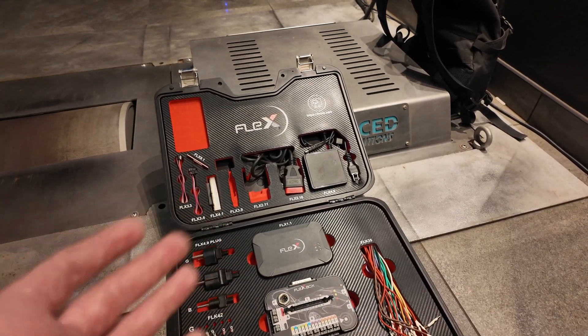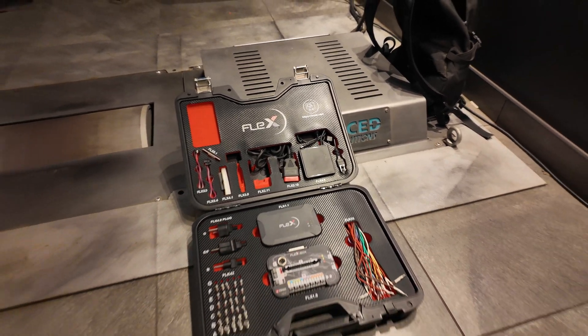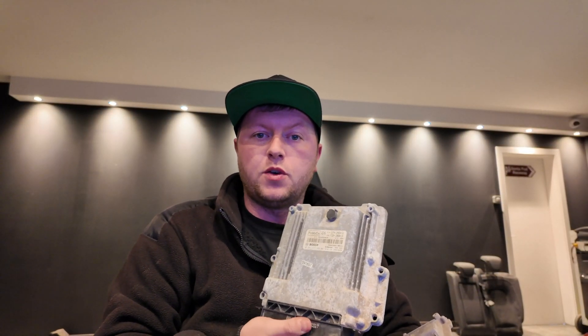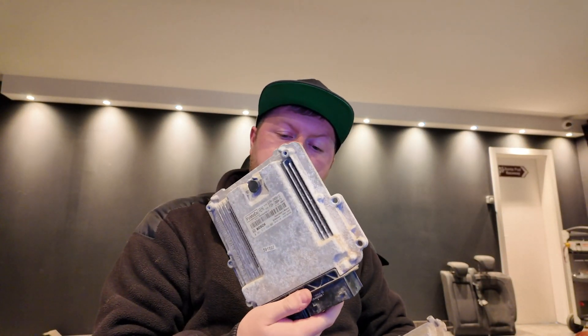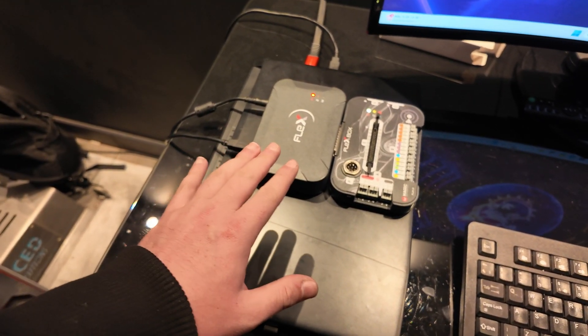The customer bought it believing the part numbers were the same, however they are slightly different, so I'm hoping this all goes smoothly. We've got the two ECUs here — the one we believe to be water damaged, as there was water inside the plugs when we first pulled it off. You can see the build-up on it. Then we have the second one which is definitely a lot cleaner looking. Hopefully once we take the data off the original we can program it to the new one and the car will start.